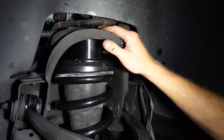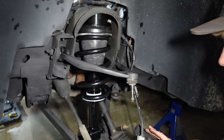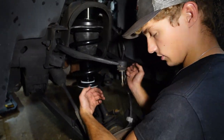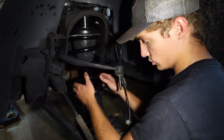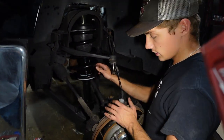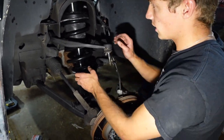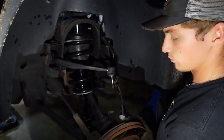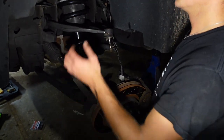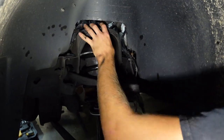So what you didn't see, since you were so close in, was, Dad, back away a little. I had my chest and my forearms, my hands were holding the strut right here, but my forearms, I was pushing down really hard on this. And as you can see how I can lower that? I pushed it down enough to where the studs would poke through, and then I let go, and that put enough tension to raise this back up to where now the studs are not gonna fall through the hole. So now,